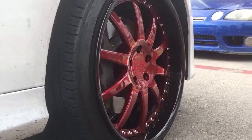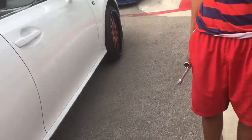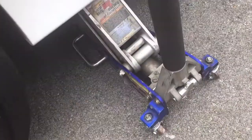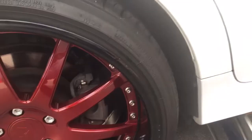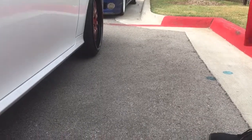Pull it out. Now, because the car is in the air — come here. Because the car is in the air, now we can tighten. We can lower the car just a little bit. We want to put some pressure on the wheels before we actually tighten it down. This is our jack — it's a low-profile jack. Righty-tighty, lefty-loosey. We want to let this car down real slow. Real slow. The car is not all the way on the ground, but because the wheels are on the ground now we can tighten it. So Braylon, take your four-way to the front and go through and tighten them down.